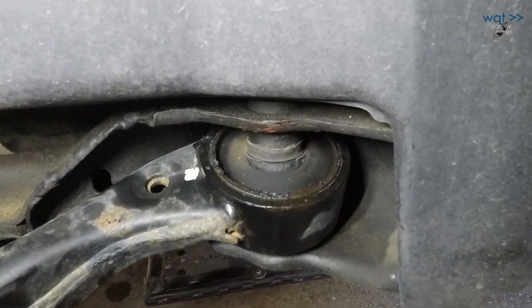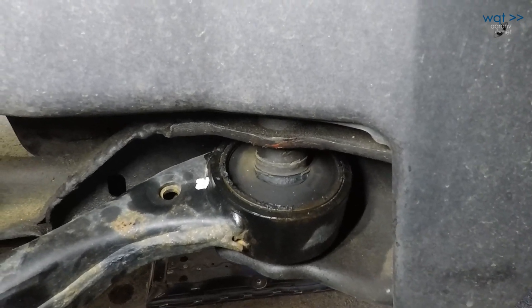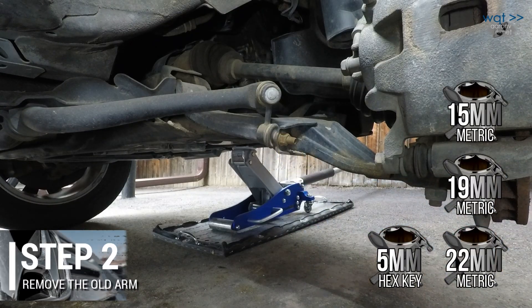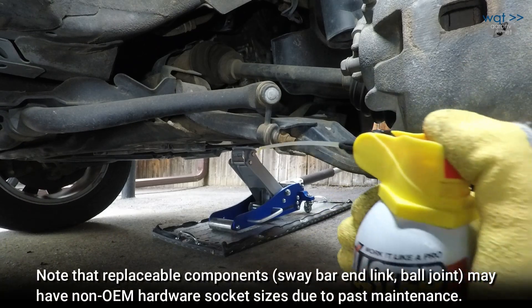Here's a perfect visual on why this is a terrible design — that's not an application for a rubber bushing. You see how it's tearing out there? As noted, we've got four bolts to remove, and again, I see rust on there, I see some dirt. So we'll hit everything with PB Blaster and hope that helps.